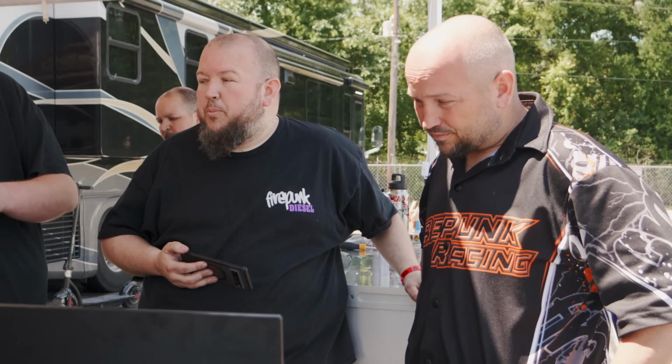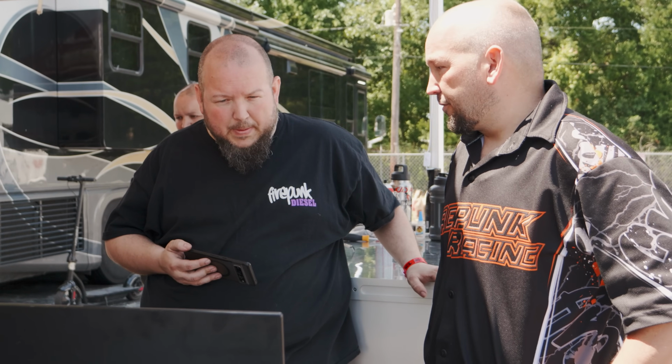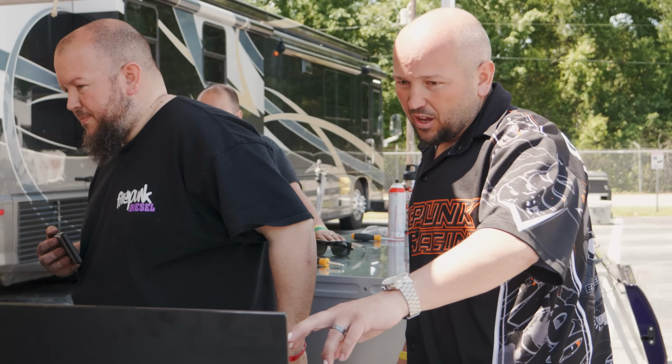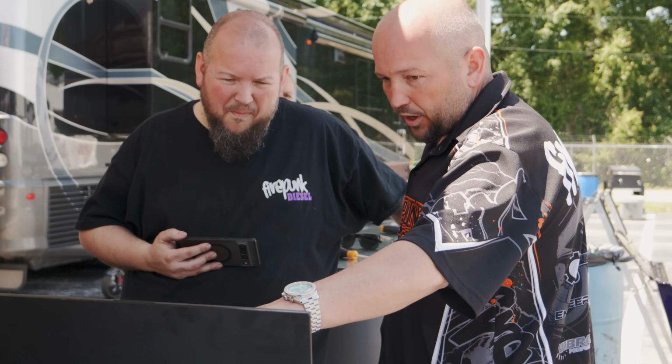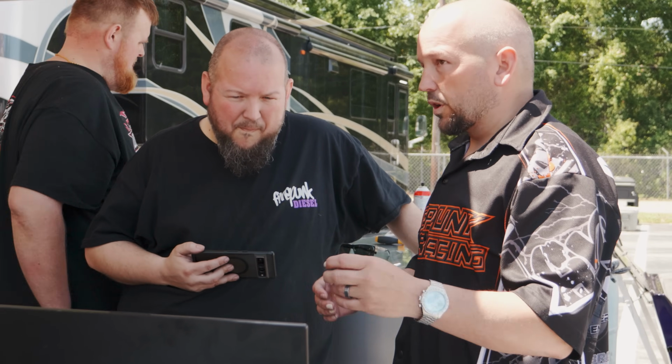Like, I'd almost like to go up 100 on this hit. Well, we'll see. I put 10 milligrams in, so if the fuel quantity's there, it's going to add a good bit more power on the initial hit. But I also see my air-fuel ratio drops before it comes up, so there is a little delay from the time the nitrous comes in. So we're going to make that first move with boost.